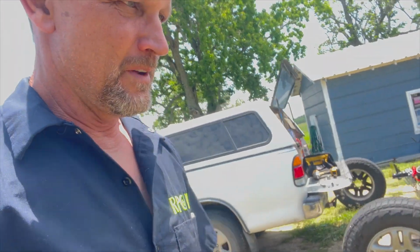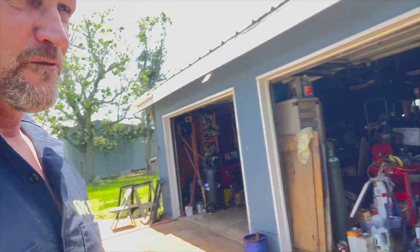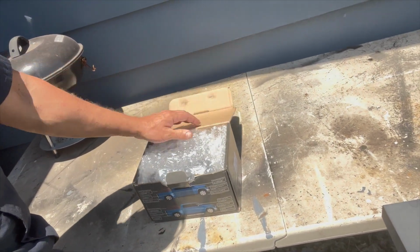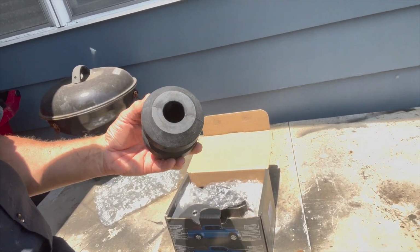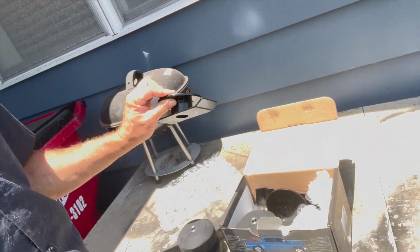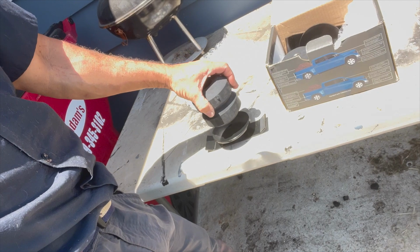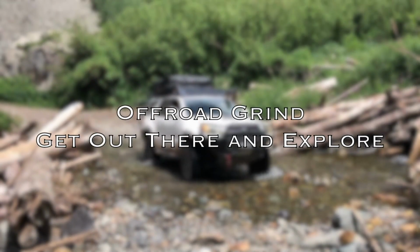So we are going to be putting in the Timbren Tortun4, I believe it's called, rear suspension upgrade. It's basically a big rubber bump stop for the most part, and they just came in today, so we're going to stick those on and get the truck all set up. It's going to go where the U-bolts are for the old bump stop, and this is going to get bolted down probably like that, and then the frame is going to pop down on top of that. So let's go.